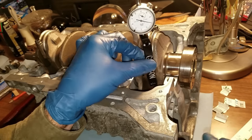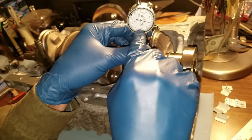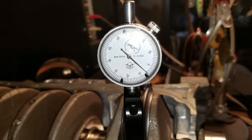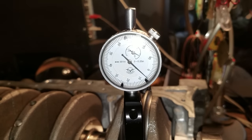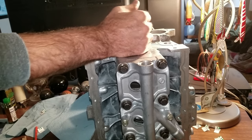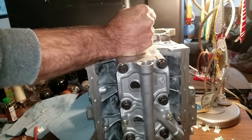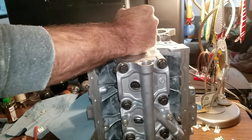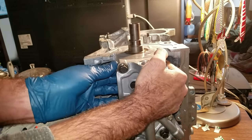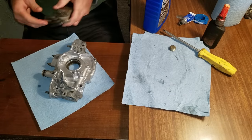I'm at about a thou and a half, which is right where I want it. I got this set to zero — I want to stretch these 55 to 60 thousandths. I'm right at about 57, which is a good number. The 55 foot-pounds they're talking about, that's a little light. I grab the top of the crank to make sure I can turn it by hand — nothing's binding up. I'm going to run stock oil pressure, I'm not messing with any of that. One assembled short block.